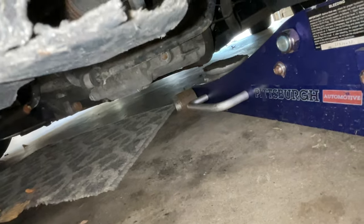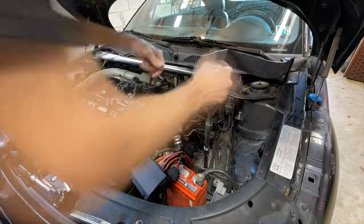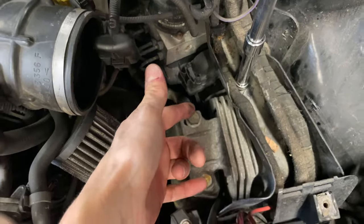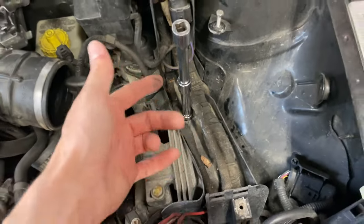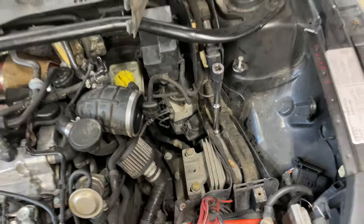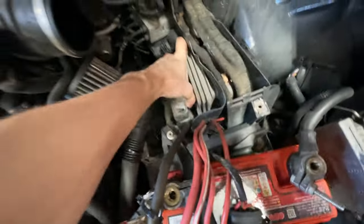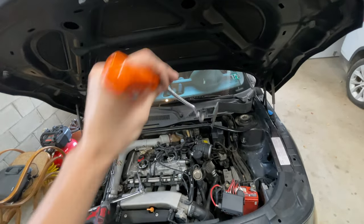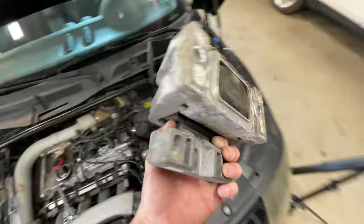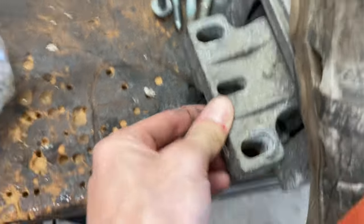It looks good — let's jack her up, just going until I feel pressure. Got all four bolts loose — these are 18s, these are 16s. Shout out to Volkswagen for designing that bolt hole through the harness housing. I got that loose, now I'll hook up the impact. Always pays to have a $4 magnet — I'll have this magnet linked in the description, bought it off Amazon. The stock engine mount is probably blown out — it does not look good.